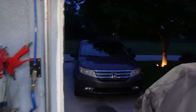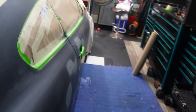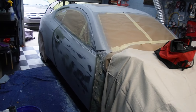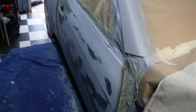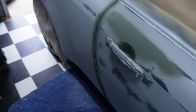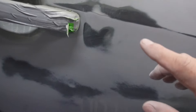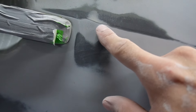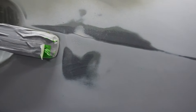When we install headers later or mess with anything in the engine bay, it's going to get scuffed up. I wanted to be able to repair it easily - with Rust-Oleum you can pick it up anywhere, scuff the area, and just spray a touchup. Instead of having to mix paint and order from the manufacturer, that's a way easier solution. The automotive base coat clear coat is going to be glossier and have more of a wet look, but the engine bay will be just fine. Everything in there gets painted black - you can see it's still blue right now.